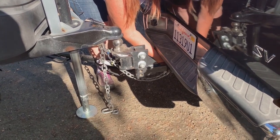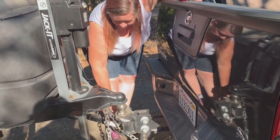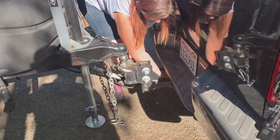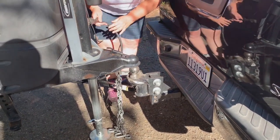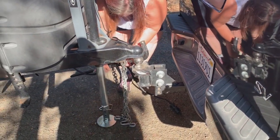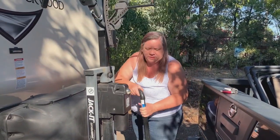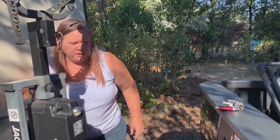Release your trailer brake cable, which we'll talk about another time. Unplug the power from the truck. And now you're ready to pull your truck away from the trailer so that you can level your trailer front to back. Turn that refrigerator on and get a cold soda.